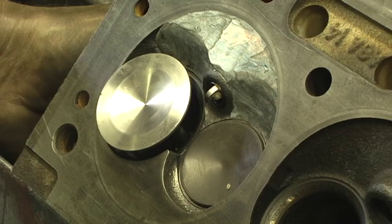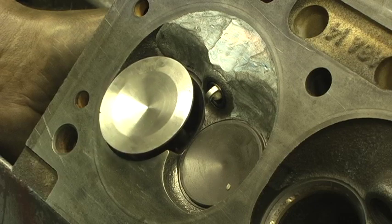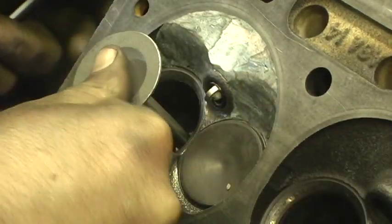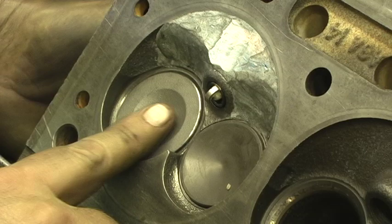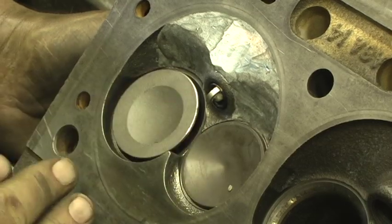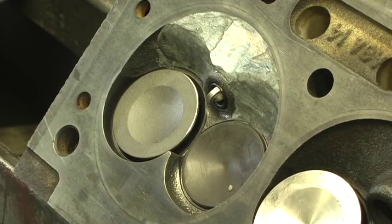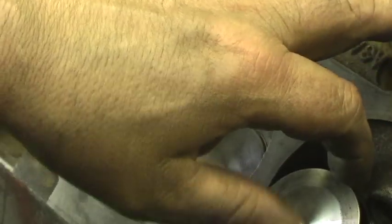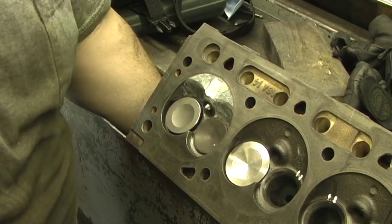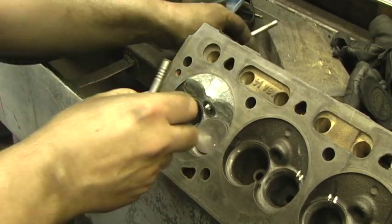You can see how as it goes up, it's unshrouding. See the kick? Now this is a stock valve — that would really be an unshroud, but we need valve diameter with this port. If you look before and aft, you can really see the difference in the valve and the shrouding. There's quite a bit of difference, but that's okay because we're going to make this chamber work for this valve.